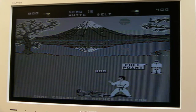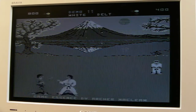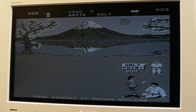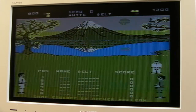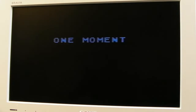I mean, if it's a GTIA, I don't know what I'm going to be able to do because I can't get one, I don't think. I've not got a spare. I wouldn't even know where to get one from. I don't think even Best Electronics have got any PAL ones. Yeah, I'll just leave it a bit longer, but then I'm going to tear it down, I think, and we'll just have a look inside and maybe take some measurements at the point where things like this are going on. We can measure around the colour stuff when it's working, and then measure around when it's not.